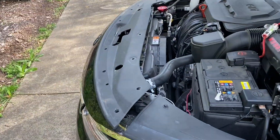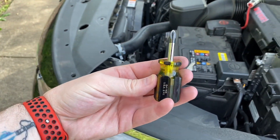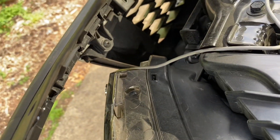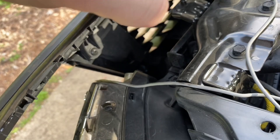Now that we have this top part of the bumper raised up, we'll need a very small Phillips head screwdriver to get in where these screws are. There's one right there and there are a few more way down in there where that blue paint is, and of course across all the way. So we're gonna get in there and take those out.